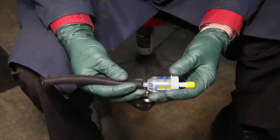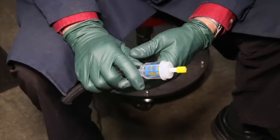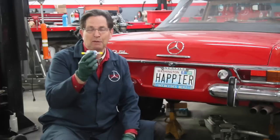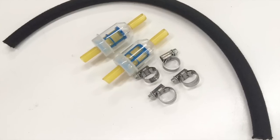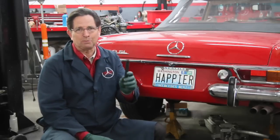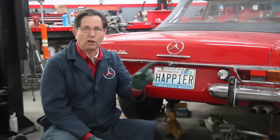We're really excited about this and decided other people will want it too, so we're going to provide a kit at mercedesource.com. Because of the variation in hoses, I'm going to provide this new filter with a hose I know will fit, along with hose clamps, and I'm actually going to include two filters. If you have one of these older Mercedes and you're not sure about the condition of the fuel tank, I highly recommend you install this visual pre-filter to protect your fuel pump and other important fuel injection components. Click the link in the description below to go right to this kit on my website.